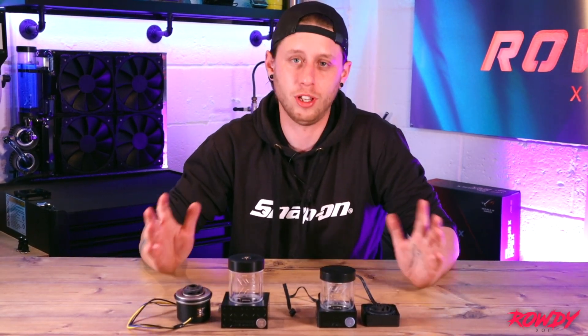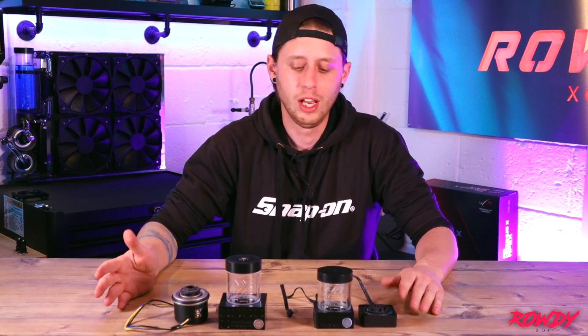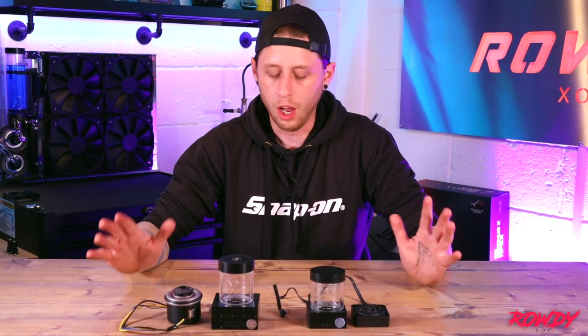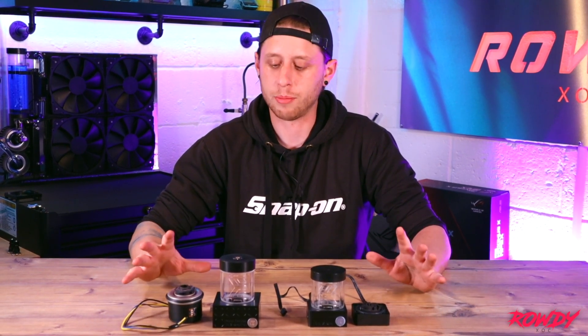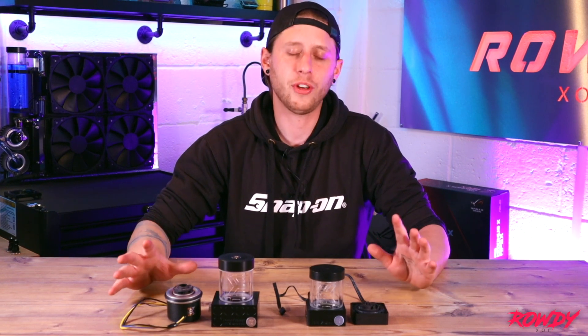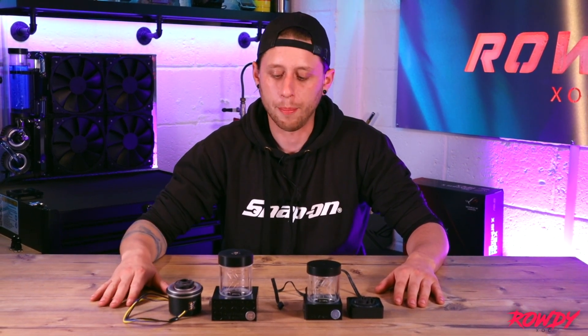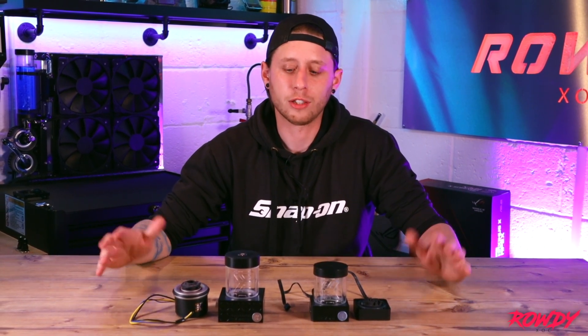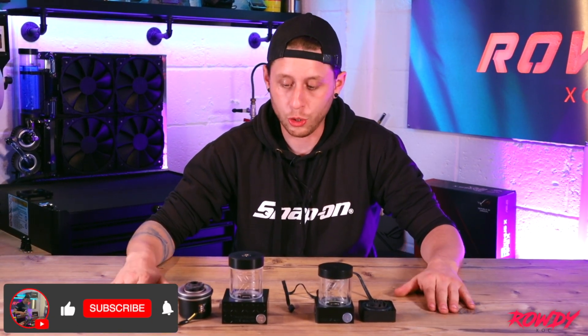You've been warned! So that is pretty much it when it comes to the two most common pumps on the market, which is the DDC and the D5. They've both got pros, they've both got cons, but ultimately if you just want a good reliable pump, go with the D5. If you're absolutely stuck with space, the DDC can still be a good pump — you've just got to make sure you have very good airflow and use that heatsink mod and you should be good to go. Hopefully that has covered most of what we need to go through regarding this matter. If you need further explanation, feel free to let me know down in the comments below. If the video was helpful to you, please do subscribe and like the video.